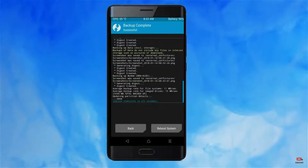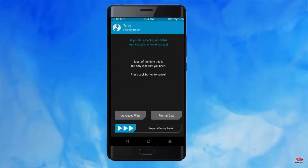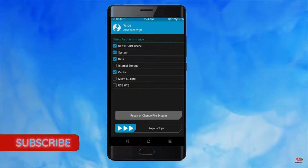Press on back. By wiping this temporary data, it will allow a clean install of this custom ROM. Select Wipe, then select Advanced Wipe. Select Dalvik cache and system data. Swipe right to confirm.